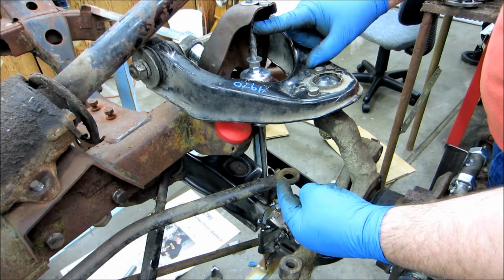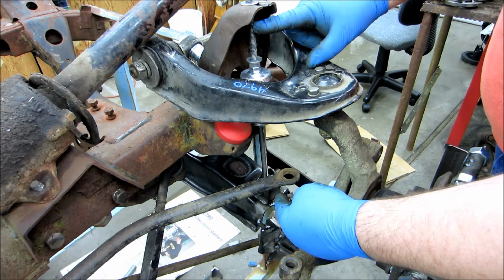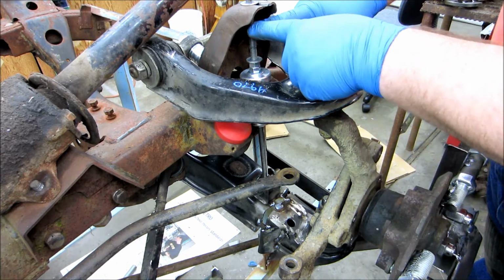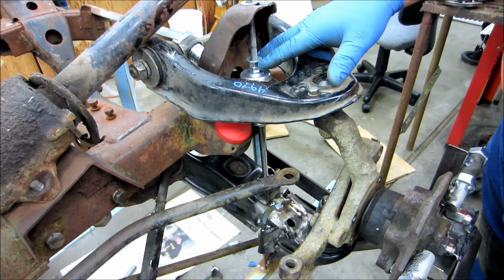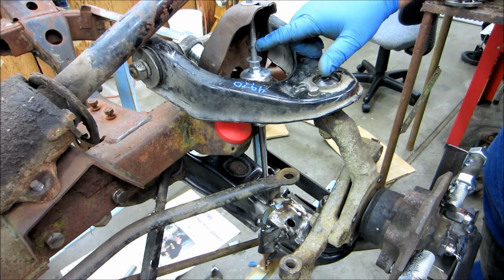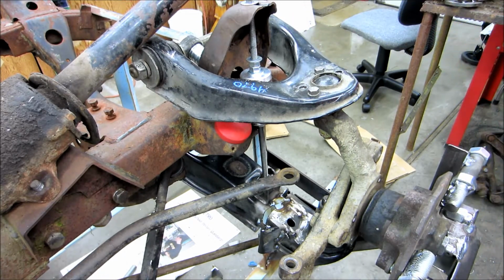I said I was missing about 3/4 of an inch to 1 inch of travel down there. So if I were to put a new shock mount on there and raise the hole up about 1 inch at ride height with the hub, that would put us in the middle of shock travel. That would also make it to where when we go all the way down, we hit the bump stops. And when I came up, I don't remember exactly offhand, but we still had plenty of room for another inch at the top of the shock travel, you know, when the suspension bottoms out. So I think I will be looking into doing that.